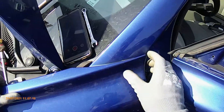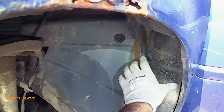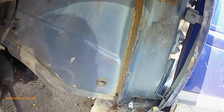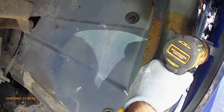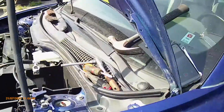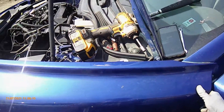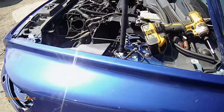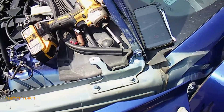I forgot to show in the intro that there is one bolt on the back side. Just remove this sheet and you'll see another bolt there that you have to remove. When you remove it, you're almost done. Just gently pull it up and remove it from the plastic panel underneath — and the fender comes out.